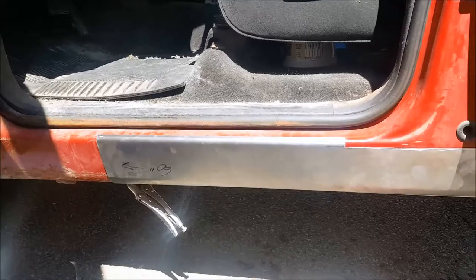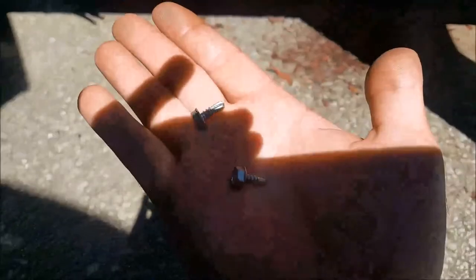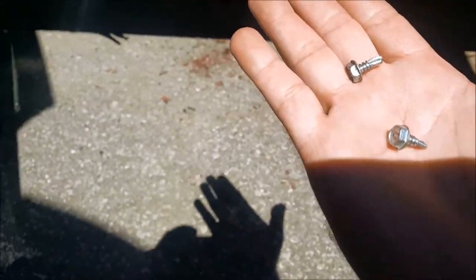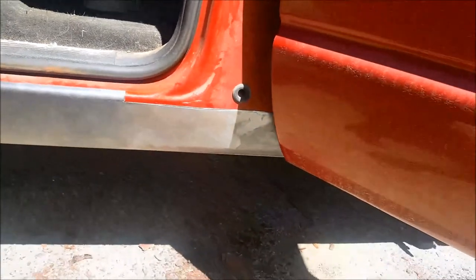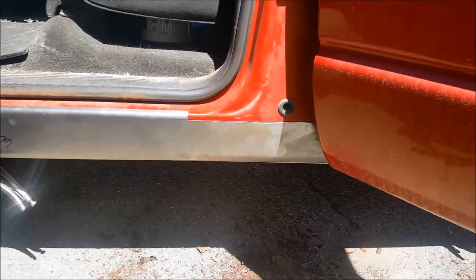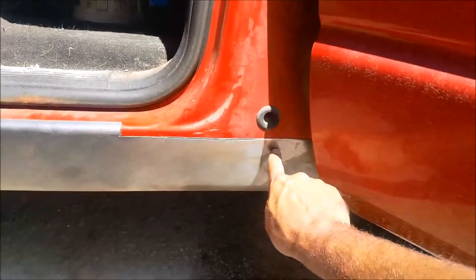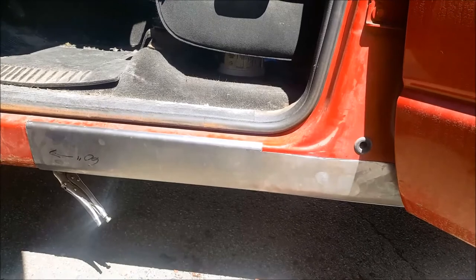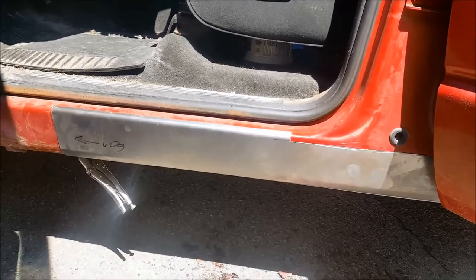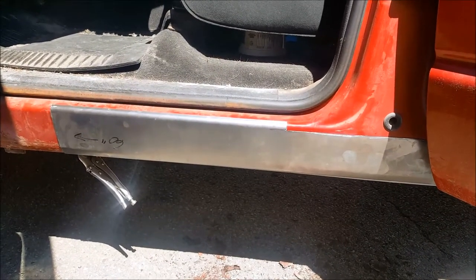Just finished getting this where I want it. Now I'm going to take a couple of sheet metal screws and drive them in — maybe here, here, and here — just to hold things into position. These will be reference points for later on. I'll keep them up a little higher. They're permanent reference points once you shoot these screws in. So if you've got things clamped in place like I have now, this is where it's going to go. Shoot your screws in — they're permanent reference points unless you cut them out.